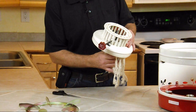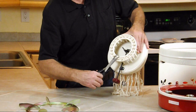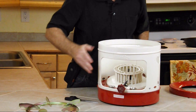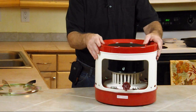After you've burned these wicks for a couple hours — let the machine oils burn off. Take your scissors while it's on the highest setting, all the way to the right, and trim using your scissors and these two guides. It'll trim the sets of wicks at the proper height. After you've done this, simply put your wicks back into the bowl in the bottom, then put your catalytic converter back in just like so, and put your ring back on.